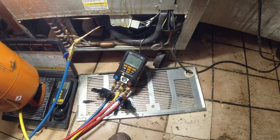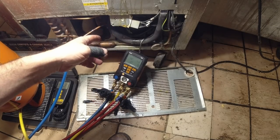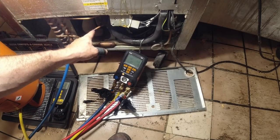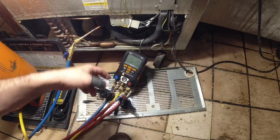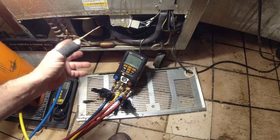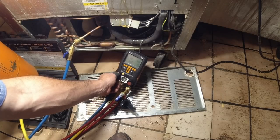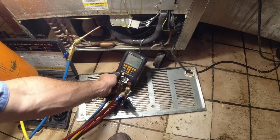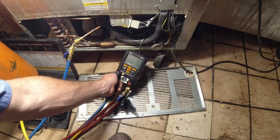It's 10:30 and they're about to get busy, so we've got to move. It's going to be one of two things: the defrost clock, which didn't seem like it was sticking, or we're a little low on refrigerant. Found the suction port, recovered it, and brazed on a cap — that's the way I like to do it, more reliable than a clamp-on. We obviously didn't let anything into the system. Now we're recharging it; if there are no problems with the cap tube we'll watch it for a week. This only holds six ounces so it's not a big deal to pull the charge and put it back in.